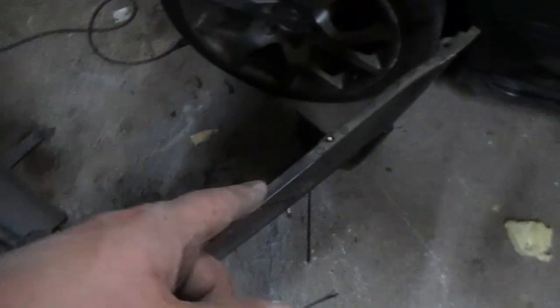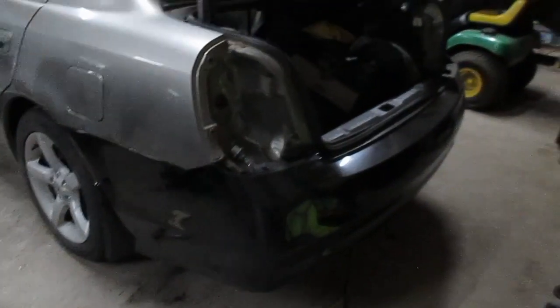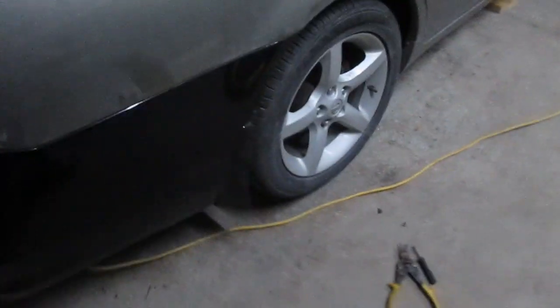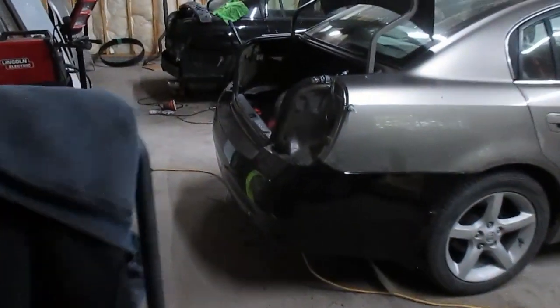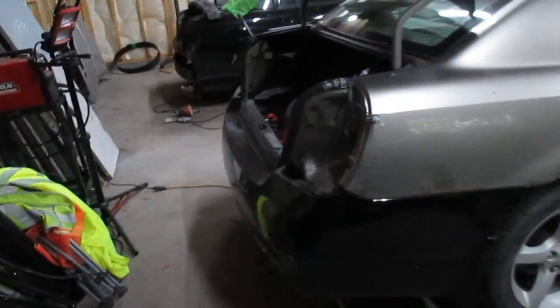The rear bumper is on. Obviously we're working with a mismatched color here, but I still think it's going to look good once we close the trunk. Coming up on it from behind you probably won't even see the silver until you get beside it. The bumper gaps aren't terrible — there are a few clips, had to use a zip tie in one spot. Now I'm going to install the tail lights and then mess around with the mufflers — get the tips off that car and weld them onto this one.